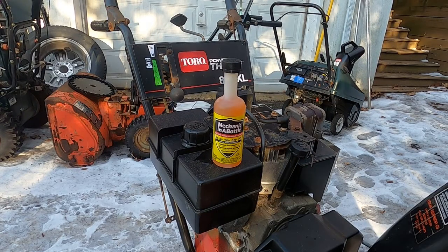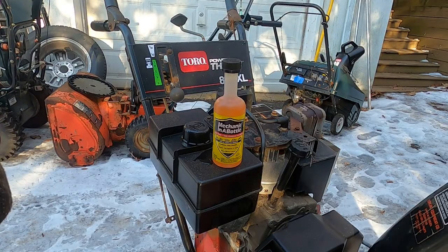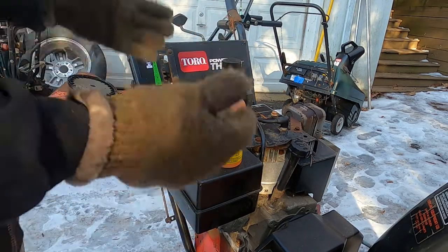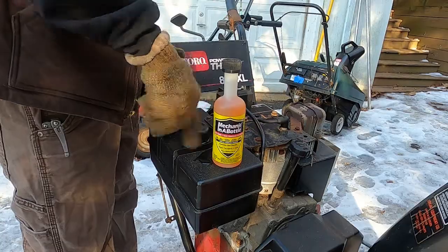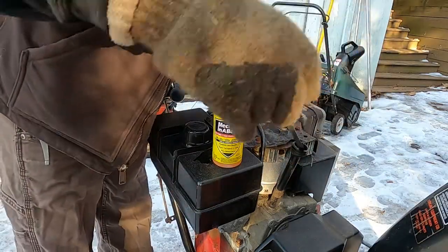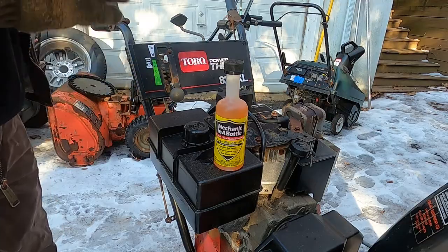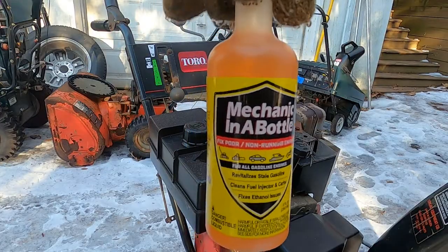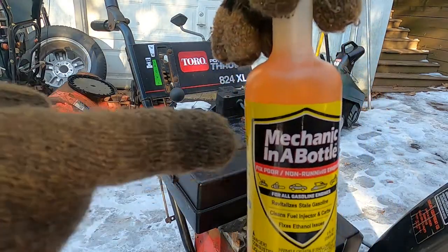What is up friends, you're watching Doug vs. Carburetor. I am Doug and this snowblower has a carburetor. Today we're going to try to get it running. Eric dropped off this Toro 824XL, an 80s model snowblower that does not run. Eric suspects it has bad gasoline — there's only about a half inch of gas in the tank. I've checked the gas and the oil, that's all I know. I could easily pull the carburetor, drain the fuel tank, clean the carburetor, and she'd be running in a half hour — but I stumbled on this stuff at Lowe's: Mechanic in a Bottle.